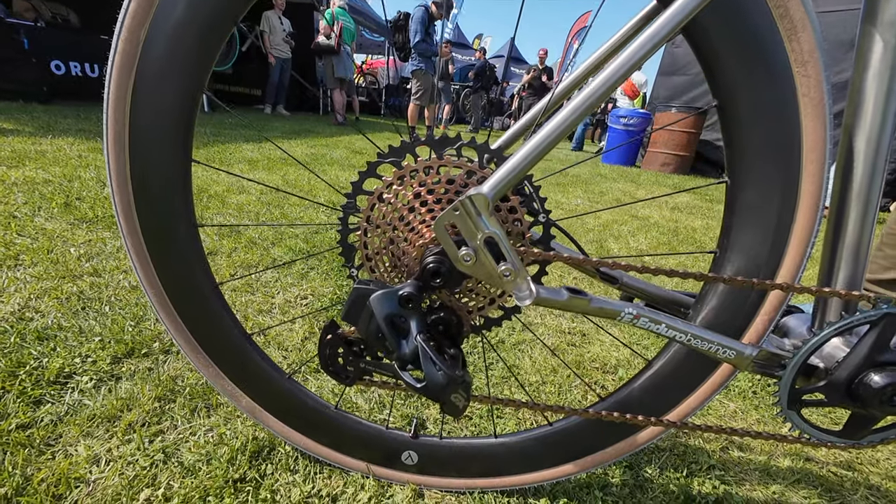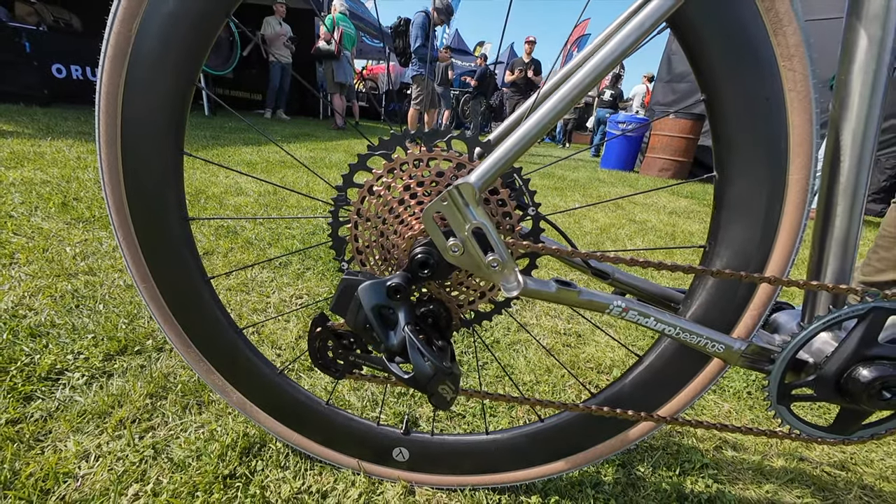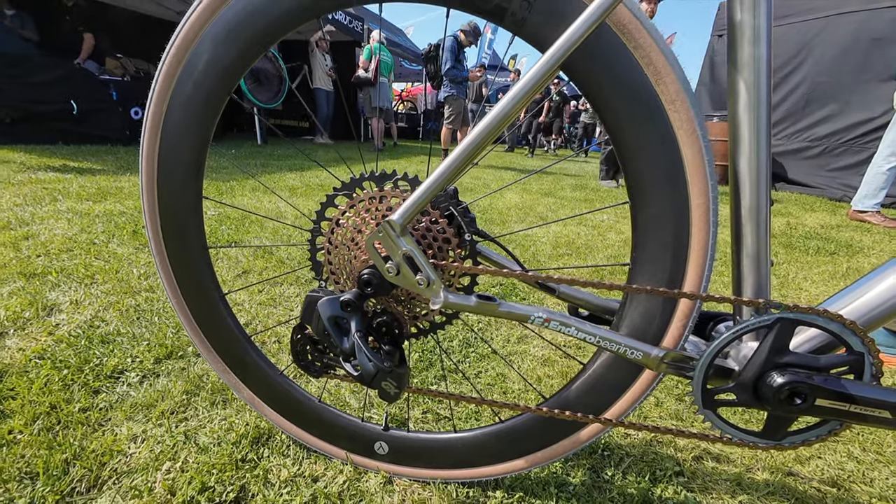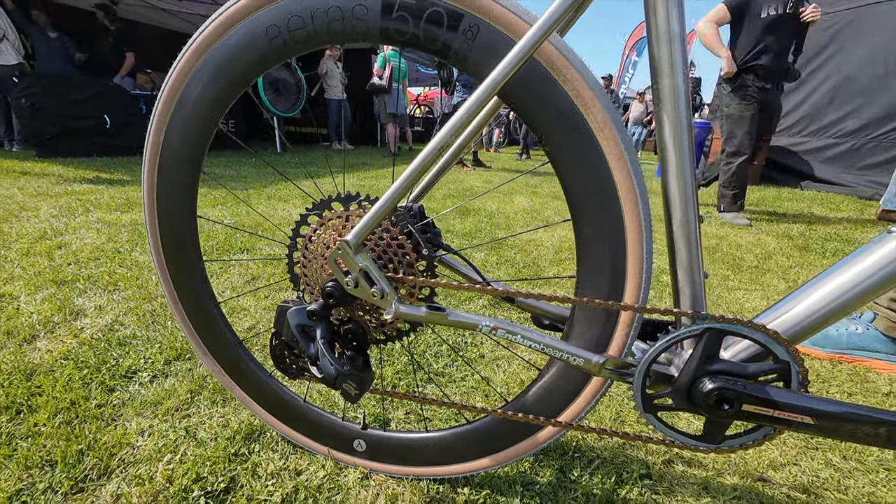There's no compromise in that. What you're accomplishing is an innovative sliding rear dropout — that's the core element. Together with a fork under development that has a flip chip 10 millimeters perpendicular to the caliper, so you can run different rotors for gravel and road modes. In gravel mode you'd run a 180, road mode a 160, and you wouldn't have to move the caliper.